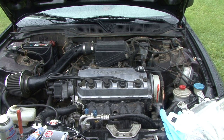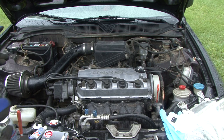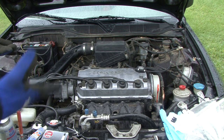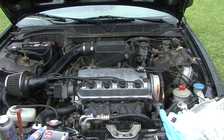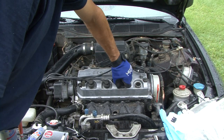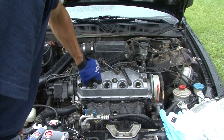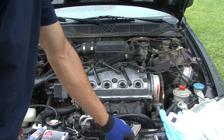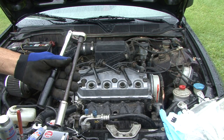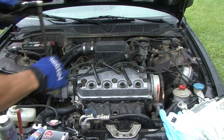Welcome to 1159 Videos. Today we're going to change out the spark plugs in your Honda Civic. This will work with a lot of other vehicles too — some of their Accords have the K24 in it and stuff, so same principle on the four cylinders. First thing you want to do is pop out the spark plug boots. The tools you need are a 5/8 socket, 16 millimeter, an extension, and a ratchet.